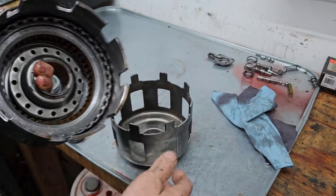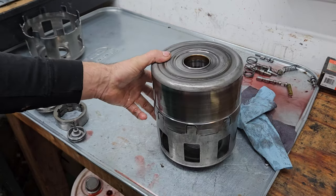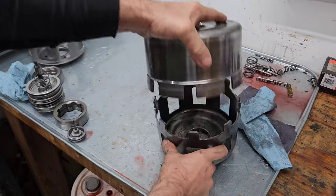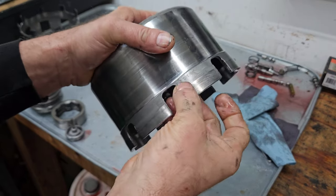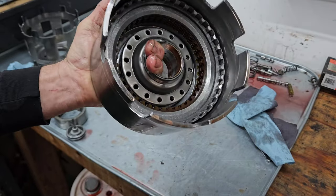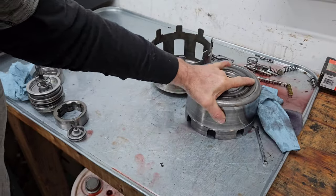These components in first gear, that setup right there, and that reverse drum is pretty heavy. That setup right there spins at twice engine RPM. If you rev the snot out of your engine, this sun shell usually won't take any damage because it's pretty light. This component here, these lugs will actually flare and hit the case. I've seen it happen one time on a Camaro, but I've heard horror stories about it happening. So that can happen.